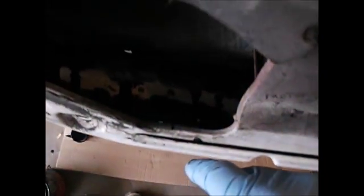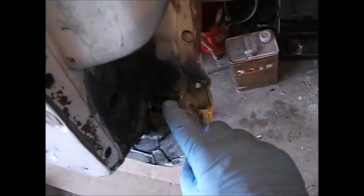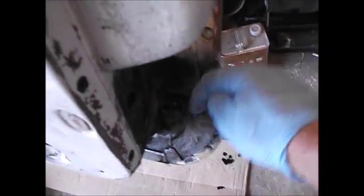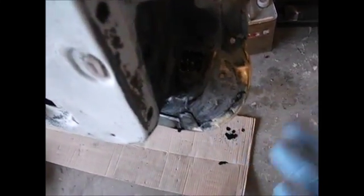I got it and then it's a little dark in there to see probably, but on the flange, the back side of the flange for my patch, I want it to wick down inside there, fill any kind of holes on the back side of the Bondo and all that, and of course on the inside of that pinch. I'm trying to work that stuff inside there and make it nice and thin. There's a factory hole, little square hole, so I got it down in there, and you wonder why water got inside here and this all rotted out.